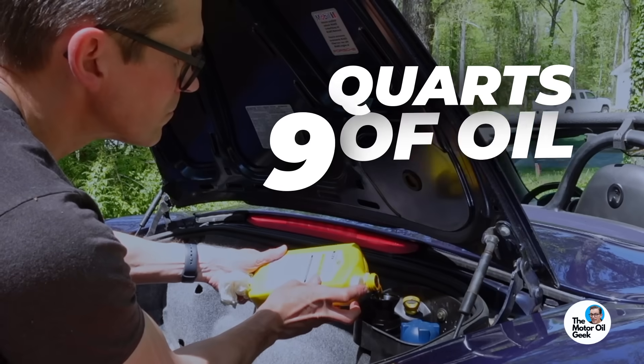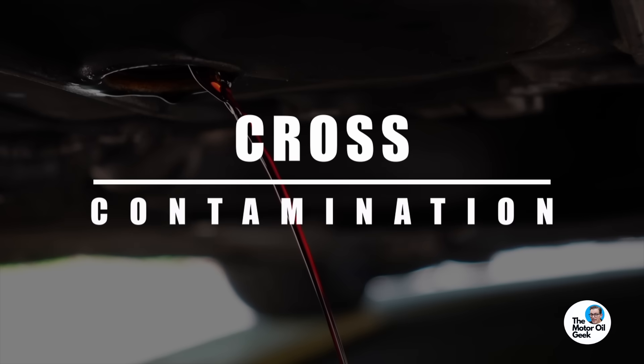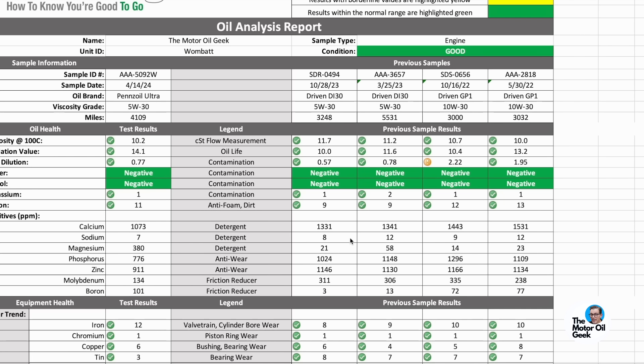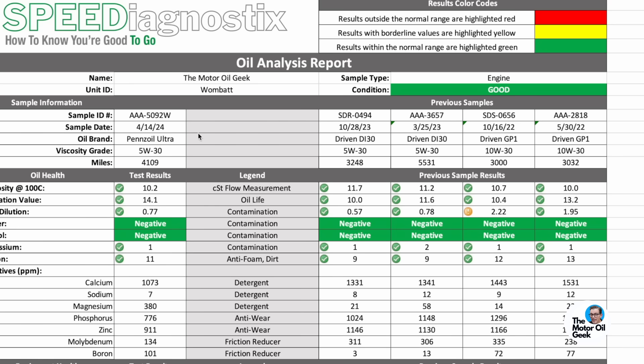There's what's called cross-contamination. For example, this engine takes nine quarts of oil, but if I put nine quarts in today, it'll be overfilled because you can't get all the old oil out. So there's cross-contamination between the first and second additive packages, and that can actually cause an increase in wear — it's definitely not showing you what the oil is truly capable of. That first 5W30 Pennzoil Ultra Platinum 4,000-mile run was basically used to flush out the previous oil.